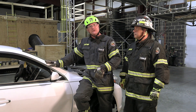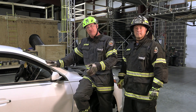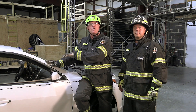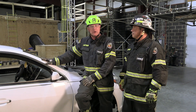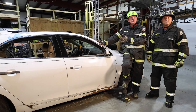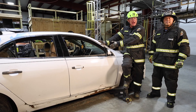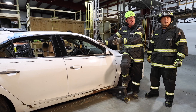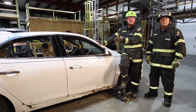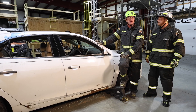The Society of Automotive Engineers has established a guideline recommending that all manufacturers install manual overrides on the interior door latches of both front doors. So even if you have electromechanical door handles, accessing the interior handle and doing two movements of that handle will release the latch and lock mechanism and allow the door to come free from the nader pin or u-bolt established into the B-pillar.